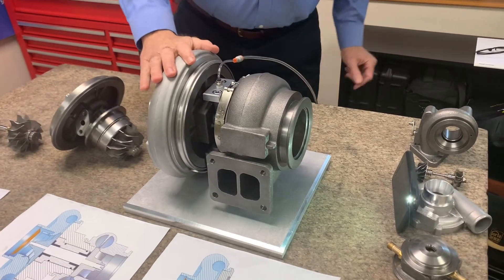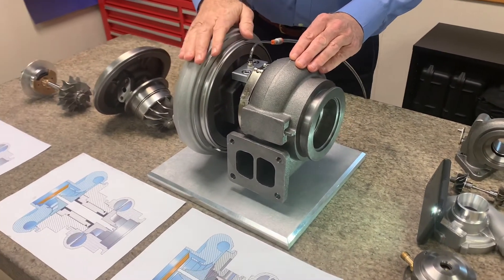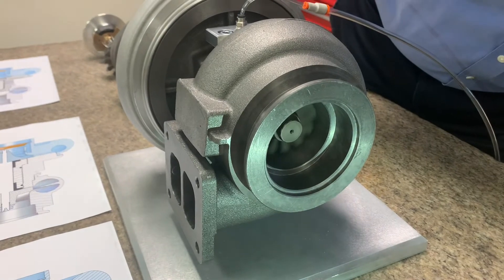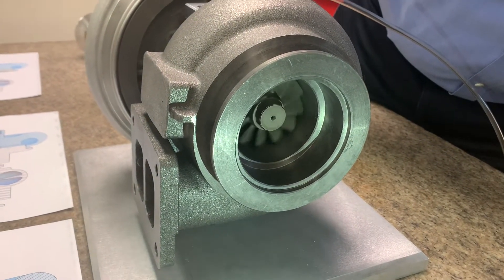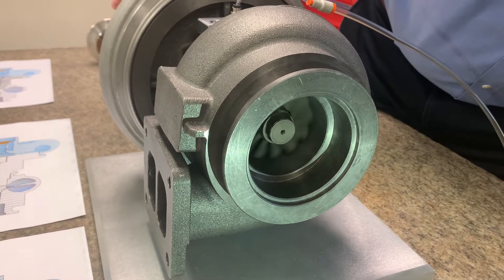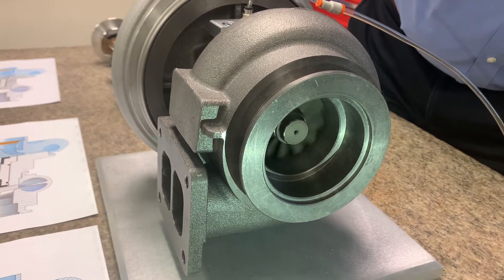It's designed for a D12 diesel engine. You can see it's got the compressor side and the turbine side, and if I spin this up you can see the turbine spinning quite freely. I can stop it from the compressor side and get it going in both directions. There's no way that an oil bearing spins that freely, and so at high speeds there's a big efficiency savings here.